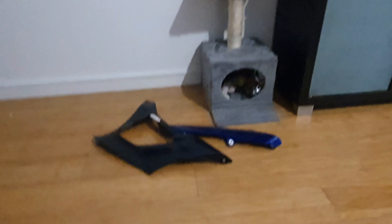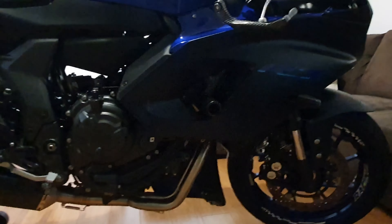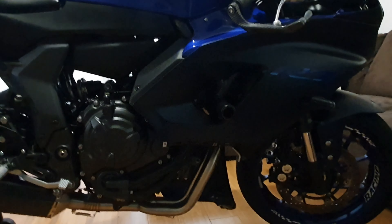So there's the update. I decided I didn't record the video of putting it on. But seriously, the hardest bit was getting the fairings off, and that was six bolts. It was four nuts on the headers. That was it. So if you get an R7, buy an old MT-07 exhaust off of wish.com. I'll do a video on the cost of the whole thing in a few days. Alright, take care, see ya, bye.